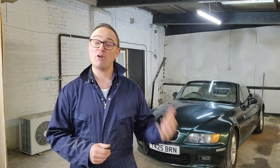And I'm going to try to use the innards of a Lexus IS300H to drive it. So that is a gearbox and motor that will replace the existing gearbox and sit in its place, leaving the entire engine bay free for ancillaries, but mostly batteries, maybe even a frunk, we shall see. Should be more powerful than the last one.